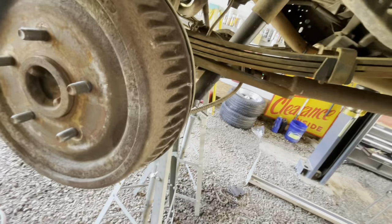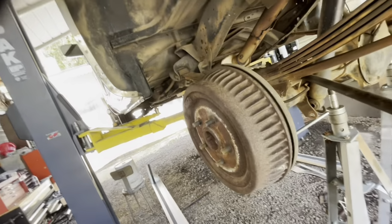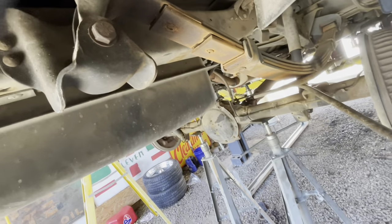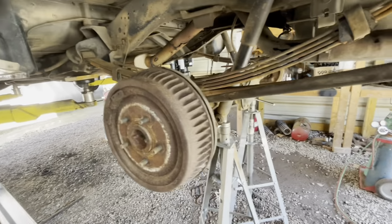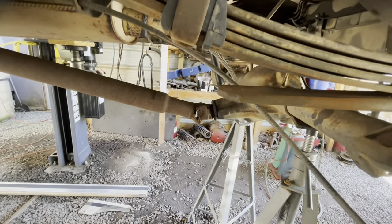And the, well, she don't wanna break loose yet. Get the pry bar after her. Where did I put the pry bar? And we'll grab one somewhere. Leaf springs are just kind of stuck to the differential. It shouldn't take much to get it loose. Well, yeah, sometimes. Those little lineup pins are just, there it goes. That side broke loose. Now, can we get this side loose? Whew. Yeah, sometimes things just, there it goes. She's loose. Yeah, and I didn't tie my string around my rear end like I usually do to keep that from falling.